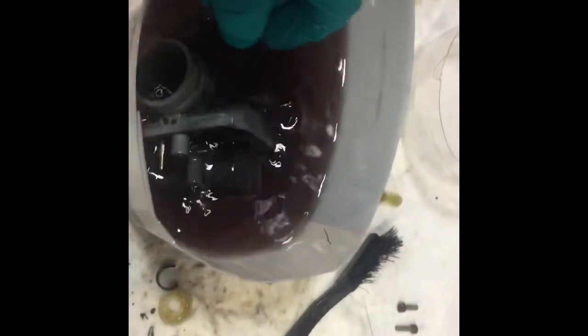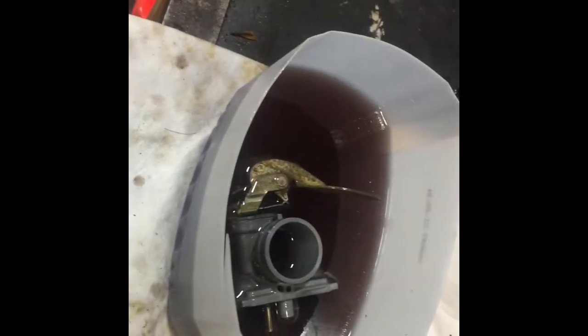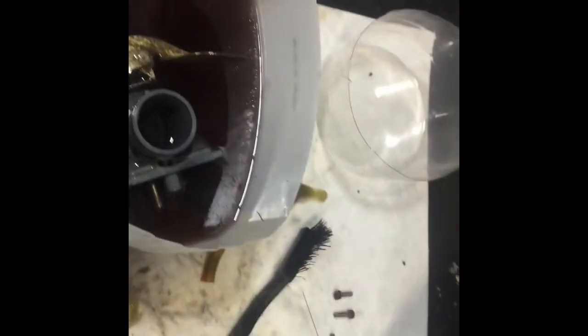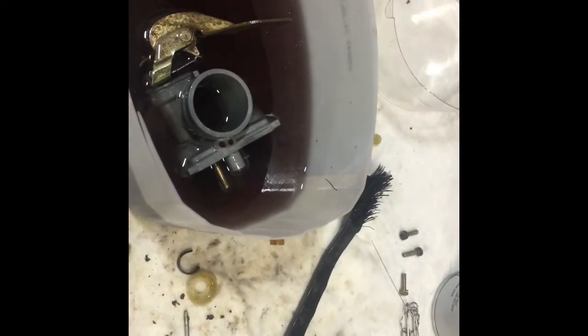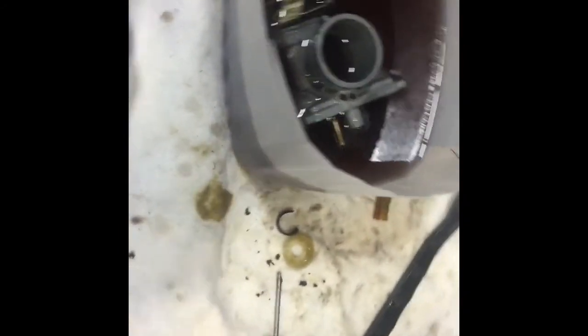It's not too much like a Mikuni carb, but what I thought was impressive is how well the Super Clean worked. If you're working on cleaning up a carb and you can't get proper carb cleaner — apparently carb cleaner is kind of watered down now and some of that stuff was pretty dangerous to work with — so make sure you've got some good gloves, nitrile gloves or something. I think the Super Clean is gonna do the job. I'm gonna clean this up today, slap it back together, and put it on the quad. I'll probably clean the petcock and the fuel tank and put some fresh gas in too.